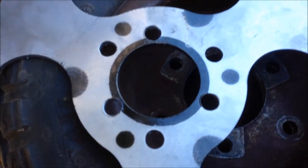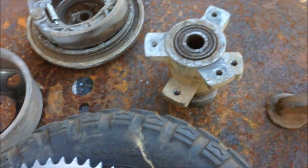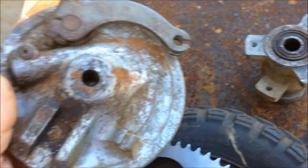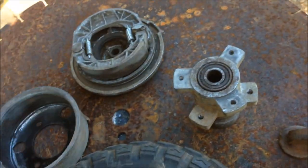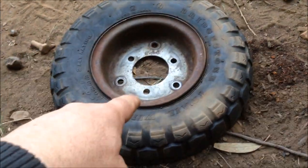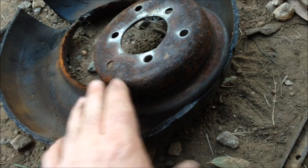What I need to do — I've already marked it — is increase the hole size and drill new holes to suit it. Because it's hard to get and people are asking silly money, I'll use it even though it isn't correct. There's also a Honda postie sprocket that fits the drum, so we're using that for the back brake. I had no luck separating the rim from the tyre, so I had to cut it. She's rusted in pretty good but the inside of the rim looks okay.